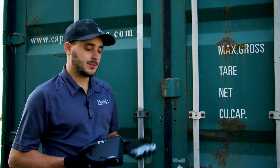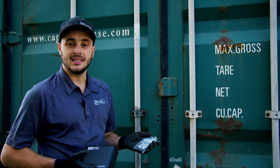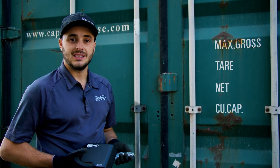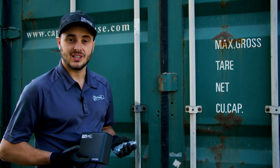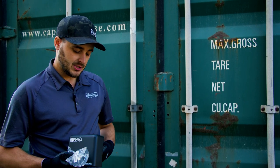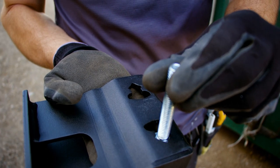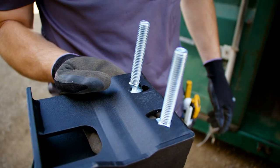The next step is to grab your carriage bolts and make sure everything fits and lines up properly. For this container, it is a non-insulated 40-foot used container. So for 20s and 40s — the corrugated steel, non-insulated cans — these are the bolts to use. It's only the reefer vans or 53s, things with a four-inch-thick door, that the insulated carriage bolts are for. Grab a couple carriage bolts on the back of the lockbox. There are slots where you just slide these in, give them a turn, and they lock in on the diamond shape — that's basically your wrench on this side of the box.